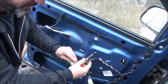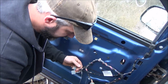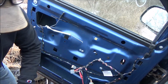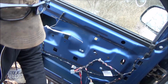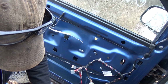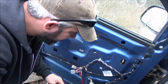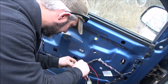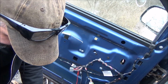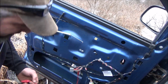Orange, white, white, blue. All right, I brought a couple jumper wires with us. There's that one. There's that one. We got our jump packs. Let's see if we can do this. Does that do anything? We got nothing. Am I on the right wires? Orange and white, white and blue. Got good connection. Hope so. Oh, don't tell me. There she goes. Whoo! Fancy pants, baby.